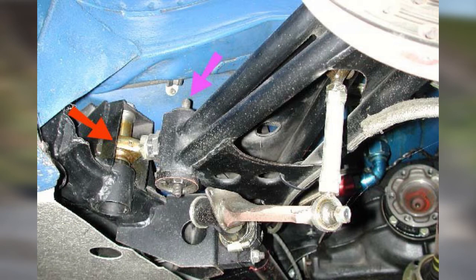The adjustment to the outer semi trailing arm pickup points was made in order to correct the roll center for circuit racing. This meant that they could fully utilize the lower sweep angle whilst not having the drawbacks of more roll.